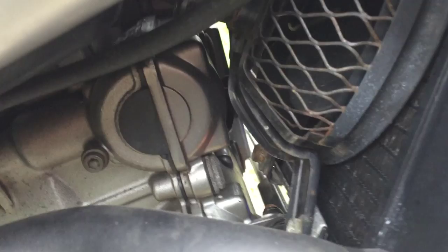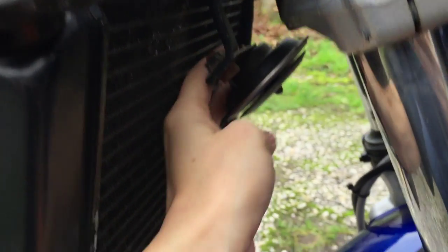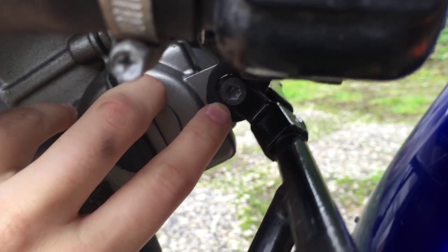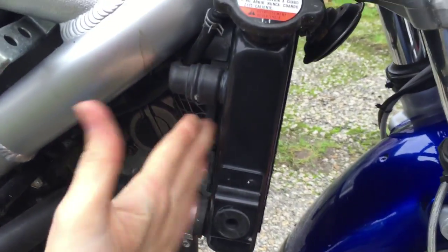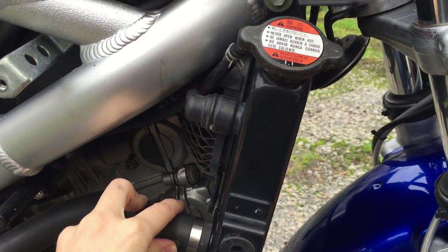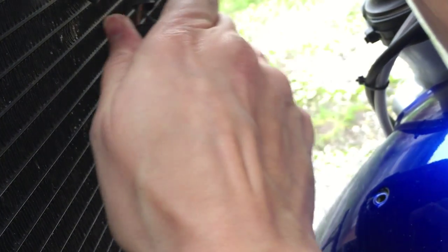From this angle you can see inside there is the spark plug itself. To begin with we're going to move this horn out of the way — that's a single bolt up there, and on the other side it's just a plug-in connector. Then we're going to undo this bolt at the bottom. On my one I've got a bracket here holding on the lower fairings, so we'll take that off. The idea is, without disconnecting any hoses, to pivot the radiator forward, maybe propping it up with a bit of wood, just so we can get to that front spark plug.